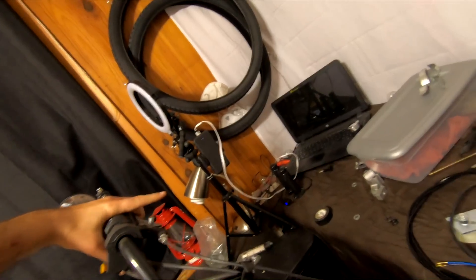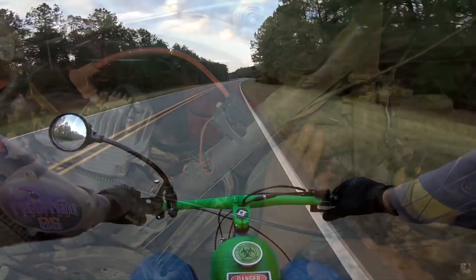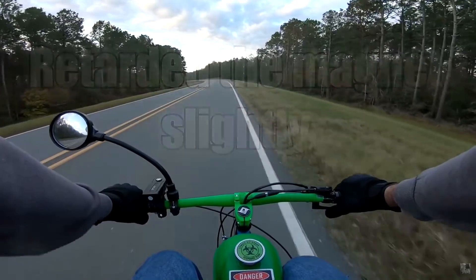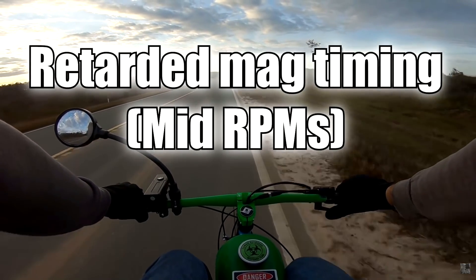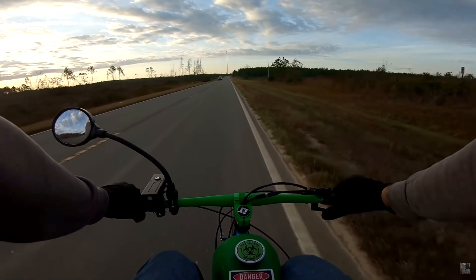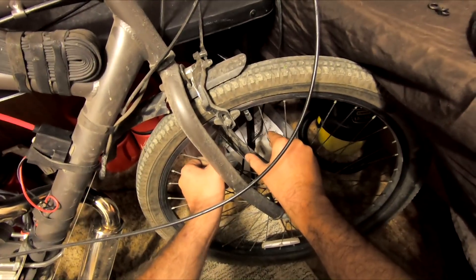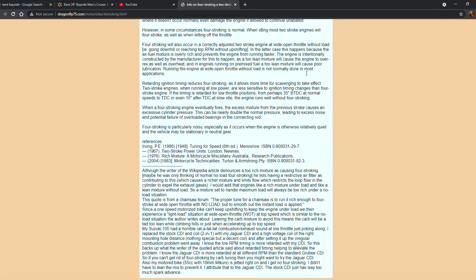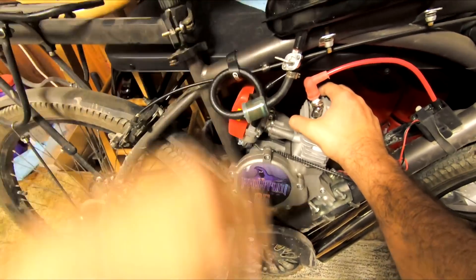Because the Phantom 85 is built on the YD100 bottom end, it suffers from the same advanced ignition timing that the YD100 does, which we've dealt with in the past. In my experience with a variety of different motorized bike engines, it's completely normal for them to four-stroke when they're under light or no load. This is explained in great detail in a post I'll link in the description, which will help you better understand exactly what we're dealing with and why. To give you a better point of reference, here's what I would consider to be normal and acceptable four-stroking under cruising load.